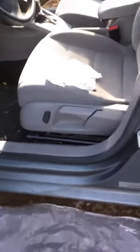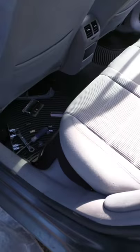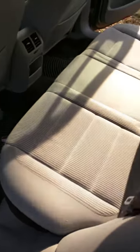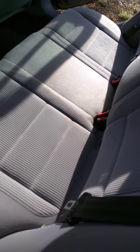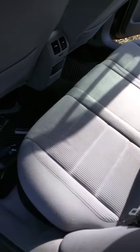There's some mold on the seats — you can see the dark spots. There's some on the side, you can see the mold spores. It's in no way as bad as my truck, but it's still there and I still take precautions, because why expose yourself to it if you don't have to? There's a bunch of mold on that headrest. I started with vacuuming with a HEPA filter, or something comparable to a HEPA. You don't want to vacuum with a shop vac, because then you're still going to expose yourself to the mold — it's not filtering out 99% of the contaminants.